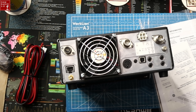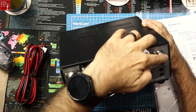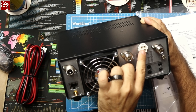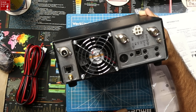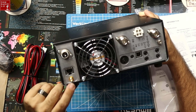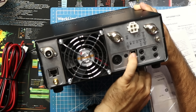This is the back of the radio — it's one of the best things I like to see, the back of the radio. So this is the 144 megahertz port right here, this is the 430 megahertz antenna, and this is the 1200 megahertz antenna. These are both Type N connectors on the back. That's your standard four-pin connector for the power cable there. There's a really nice layout of what all the ports are — a little legend or guide. Let's see: Ethernet, REF 10 megahertz — I think that might be GPS, I'm not sure — accessory port, data cable, USB-B.